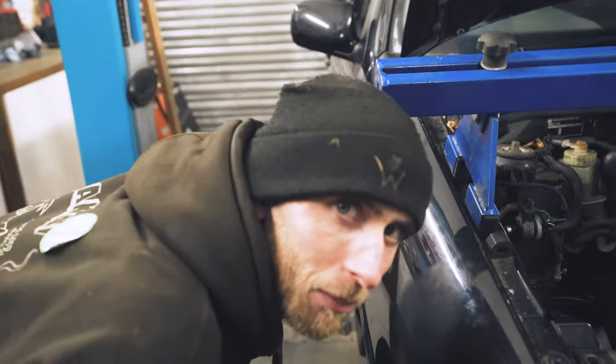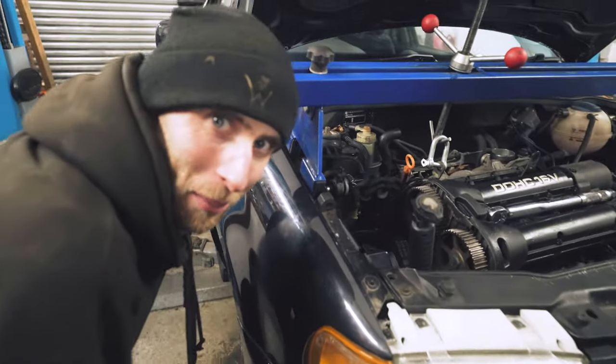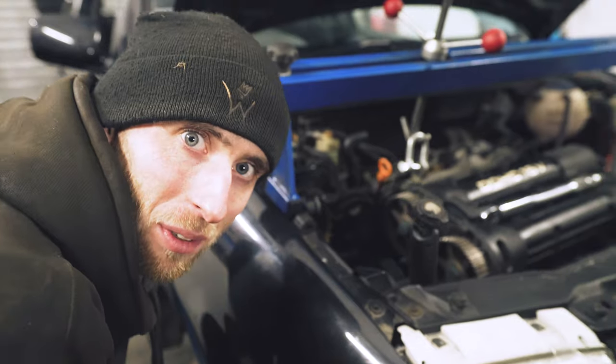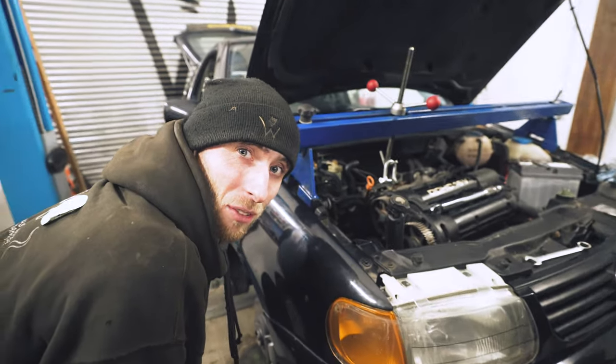Moogly moogly. Right, at the moment, it's gone a bit Pete Tong. George is twisting the cams with his fingers. Yes, sir. It's gone a bit Pete Tong. We've basically been trying to get the belt back on, but there's so much tension, even with the tensioner released, that we can't get it on. In the process, the cams have shifted a little bit because VW don't let you lock the engine up.